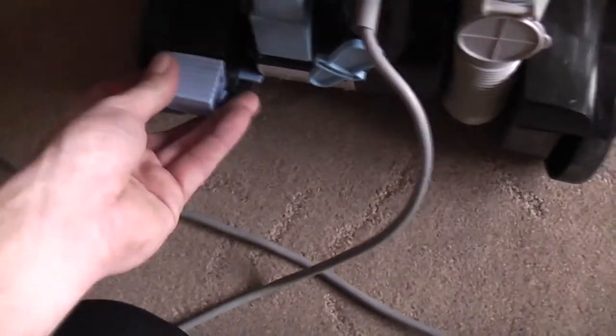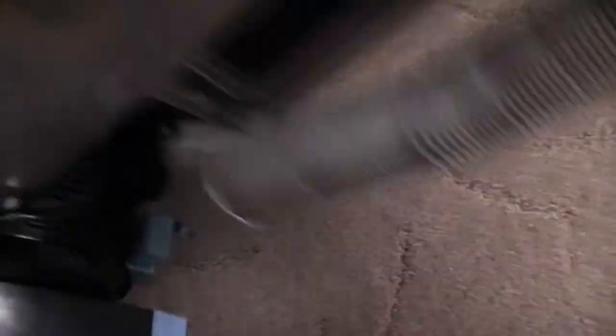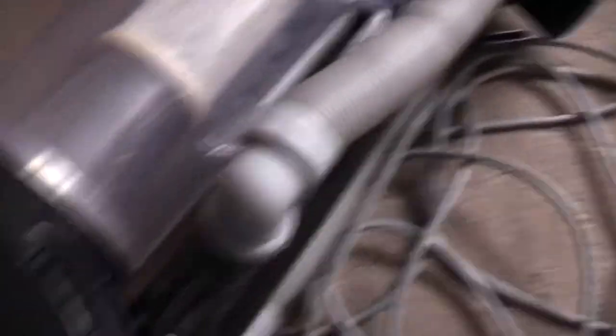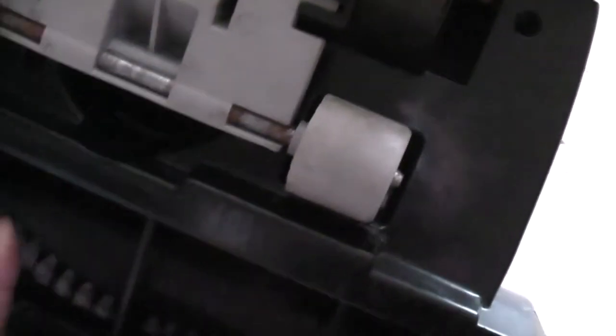The release pedal is a bit loose, which is a bit of a shame. It's very worn — a very worn-out machine, this is. That's very apparent by the wheels. They are greased and even though they're greased they're still very scratchy. In fact, one of them was nearly worn through on the axle, so it's had a lot of use. If we just turn it upside down, have a look at the brush roll — which is quite worn actually. It's worn at an angle, so where it's turned the same way for so long and been used for goodness knows what, it's gone very soft and very strange.